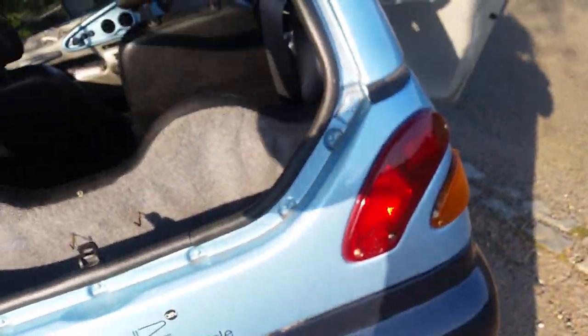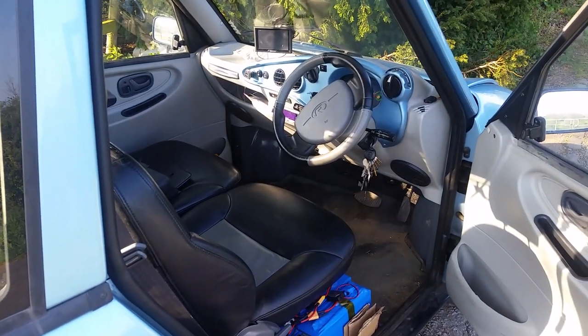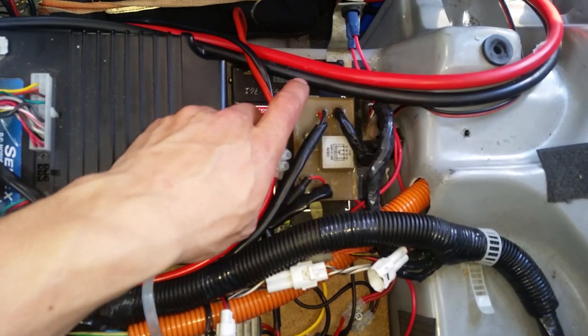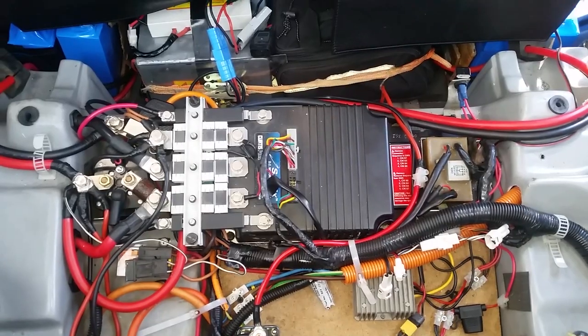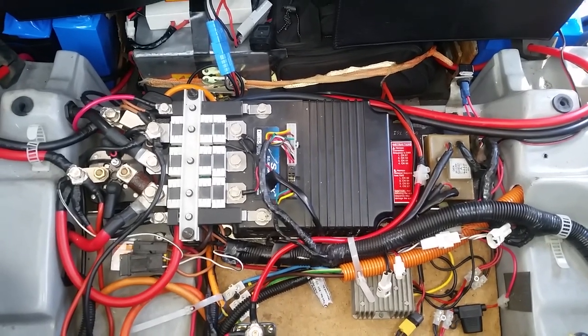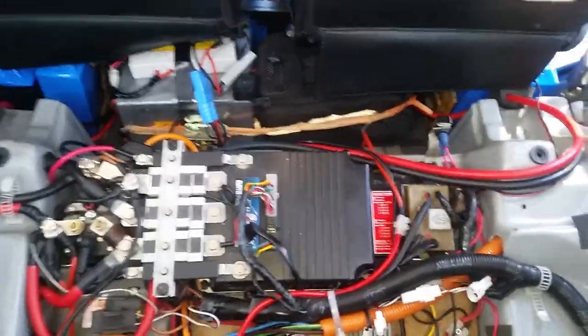All the regen and everything seems fine. So hopefully it's nothing completely required. I have a feeling it was just a solenoid or a contactor of sorts that would switch on with the 12-volt system, which for some reason doesn't seem to be working. I wonder if that's to do with the controls and the batteries, because originally there were battery monitoring cables and the heater and everything was designed to switch off below 25% state of charge. So I reckon the contactors weren't engaging to provide power to the air conditioner and the heater because of the lack of monitoring cables that go to the original lead acids.